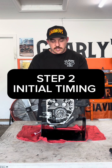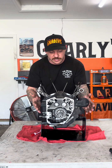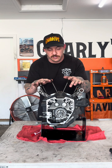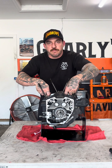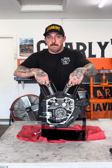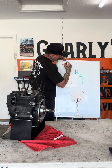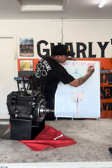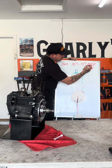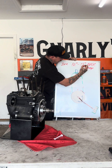Let's talk about the crankshaft and bottom end. Here's the bottom end — thank you to my friend Vinnie Corby who donated his whole bottom end to the Gnarlies channel after bearing failure, so now we have a real training aid. Let's say we start the motorcycle and it's moving at 950 RPMs. On idle, we're going to say that the spark plug fires about 10 to 15 degrees before top dead center on the compression stroke. So before top dead center, we fire the spark plug 10 to 15 degrees.